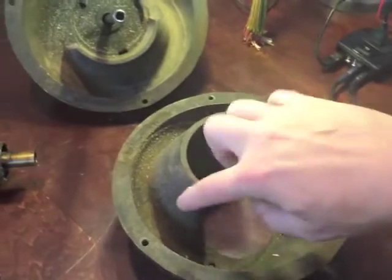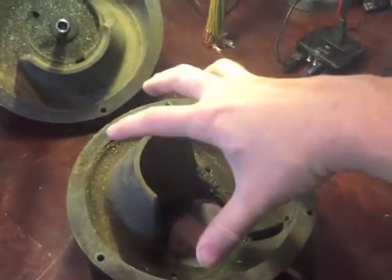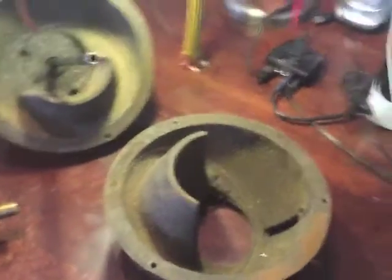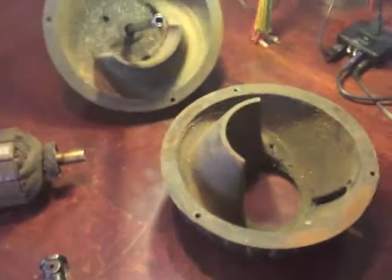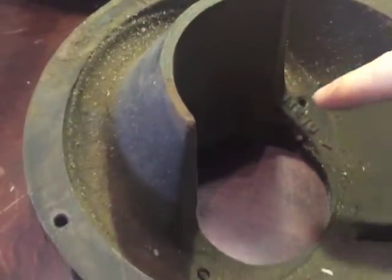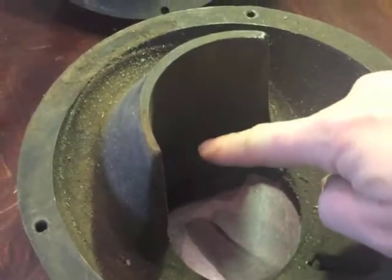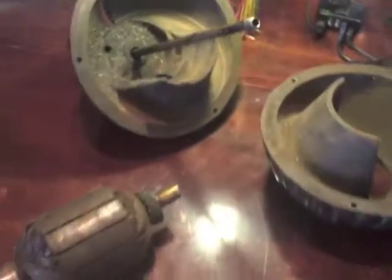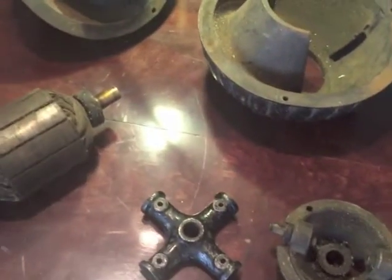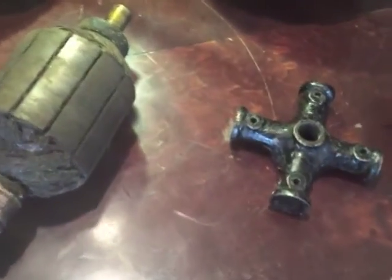The top side would come down and clamp, so that a big gigantic motor coil in a big donut shape surrounding the armature and the poles would get clamped down by the two halves of the shell. That's just cool. You can even see casting numbers there, and holes for the motor coil leads to go down to the brushes. There's not much venting — a slit here and there, and some on top. The motor is a little smaller than other DC ceiling fan motors I've seen, but in its smallness it's just refined. Really neat to look at.